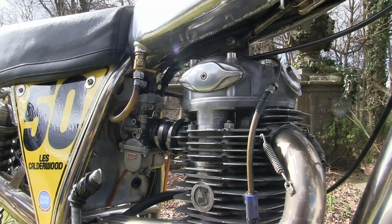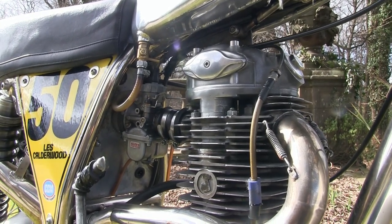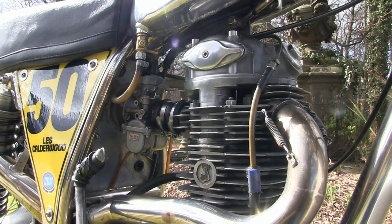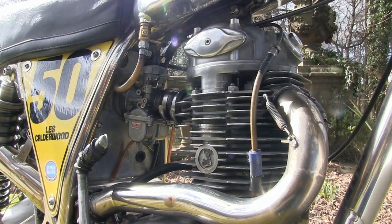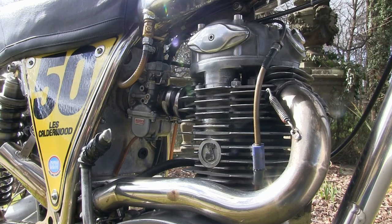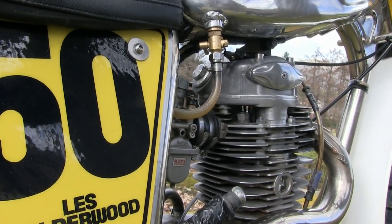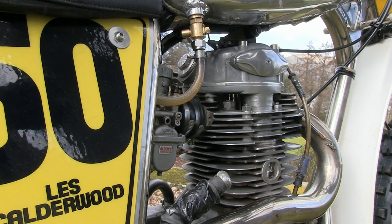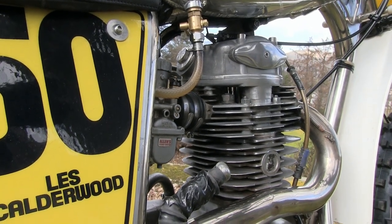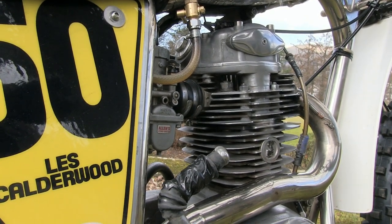And so moving on to our 1974 CCM power plant, which is based on a BSA B50 single cylinder four stroke motor, which back in the day was basically just a road going motorcycle engine that Alan Clews then retuned and reworked to give it a lot more power. So what we're looking at here is a BSA B50 SS street scrambler engine, and this engine has a bore of 90 millimeters and a stroke of 90 millimeters also, which roughly equates to around 580 cc's.